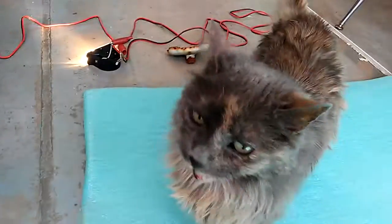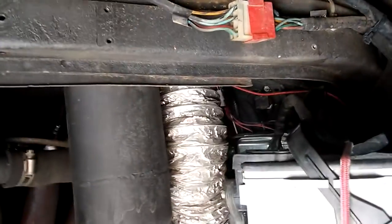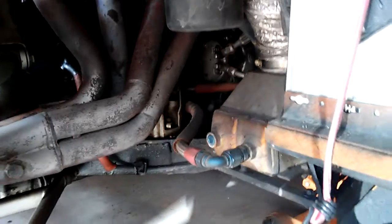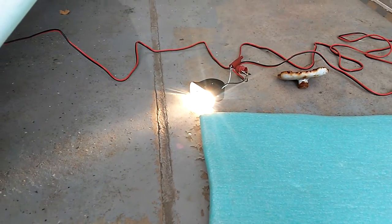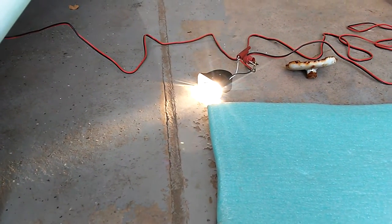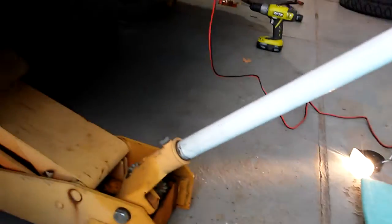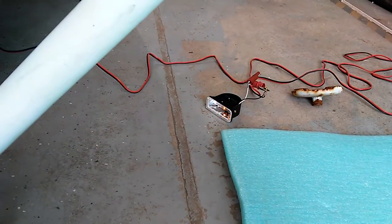I have my helper here and you can see this light is full bright right now and hot because it's been going for a while. I'm going to unplug this plug that is feeding the lights on the rear of the car. This works on any classic car — any car of any type, you can do the same thing with a load on the shorted circuit. Make sure the load is relative — if it's a higher amp circuit you might need two lights, like if you're running the whole headlight circuit. So I'm going to go ahead and unplug this wire... and there it goes.